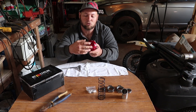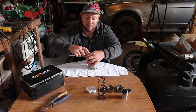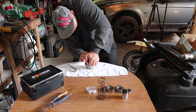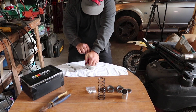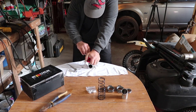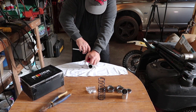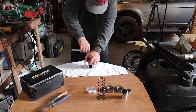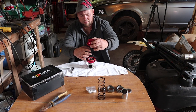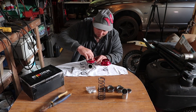The thing actually turned out to look pretty nice inside when I took it apart. To take apart a wastegate and change the springs, you can see I'm pressing down on it - I take my allen key on a ratchet wrench and unscrew these while making sure I hold down pressure. If it starts popping up while you're unscrewing, you can strip either the wastegate or the screws - they're both aluminum so you don't want to cross thread them. Use a clamp to be safe.